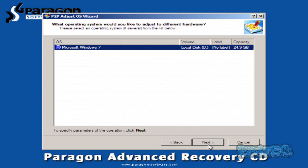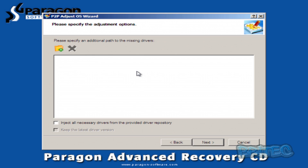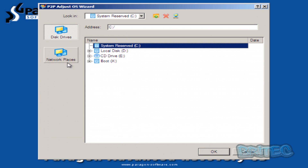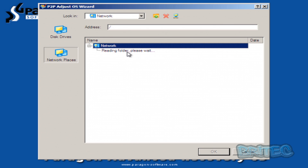Click Next, select the operating system, leave the top one, and go to 'Set parameters for the operating system adjustment.' Click on that. This is more of a manual way — you can add a folder to the driver source list. Depending on whether you've got a driver package or the actual CD, you can click on this to add those in. Every single motherboard manufacturer will give you a CD inside the box — you can place that into the drive and add those in. You can see here it shows on the E drive. You can also do this across the network if you've got a mapped network drive. Up at the top there are three little icons.